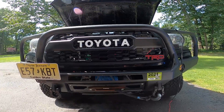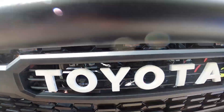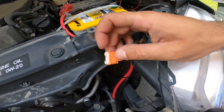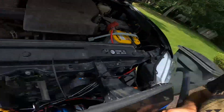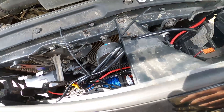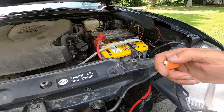She's all done. Make sure you go through your checklist when putting this back together: make sure you hook your speed sensor back up, and if you're installing raptor lights like this kit came with, make sure you hook those up. I'm using a quick disconnect clip for the raptor light wiring just in case I ever need to remove it, and make sure you run everything correctly to the battery. I also used a zip tie to secure the raptor light wires so they don't clunk around and contact the radiator. I'm going to wrap the quick disconnect in some electrical tape just to keep it from getting wet.